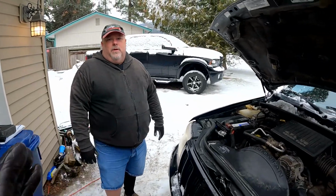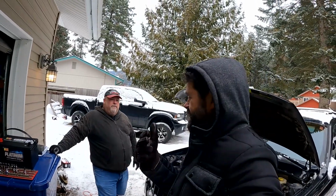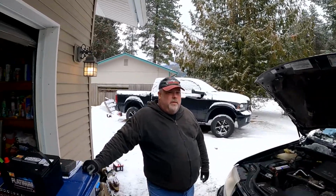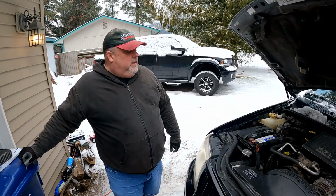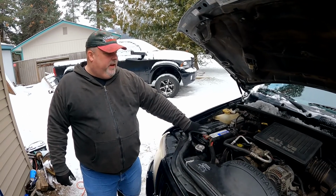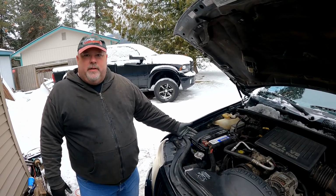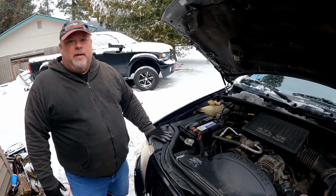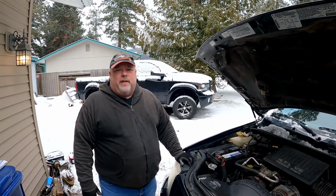Okay. Now, I think some people would probably say, well, don't you take the positive off first? Because I've heard people say that. Now, I don't think that it's because they necessarily have any particular reason, except isn't that the power? Don't you want to take it off? So say again why you take the ground and not the positive off first? Well, when you're wrenching on this, the main thing you're taking the negative off first for is if that's still hooked up and you're wrenching here and you accidentally touch something grounded, some metal on the vehicle somewhere, it can burn up stuff in your electrical system, which you don't want. Damage the computer, actually damage wiring, catch stuff on fire, all sorts of fun stuff like that.